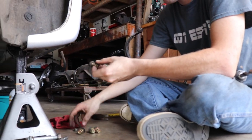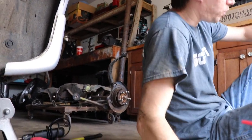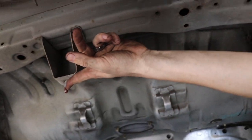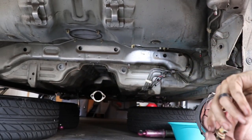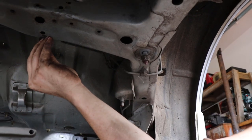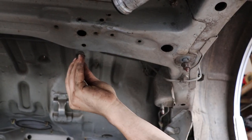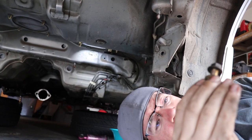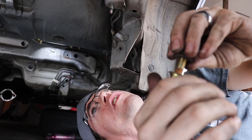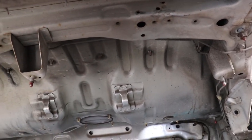What are you doing Tyler? I'm actually going to make some boltable hardware that I can put in with Loctite. Instead of having studs like this — you can see the original gas tank nuts here and here, four more back there — what I'm going to do is drill that hole a little bigger and slam the bolt up through the hole, put a couple good fat tacks on there after I clean this off, and weld the nut to the frame. This hardware is already plenty long enough to bolt the gas tank into place. I don't have to cut into cross-members, I don't have to do anything extreme. This is a pretty clean and straightforward fix.